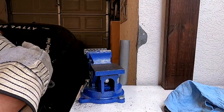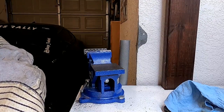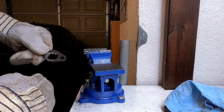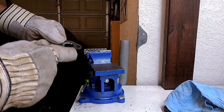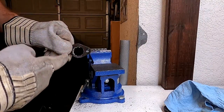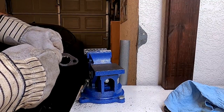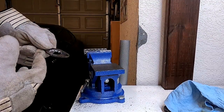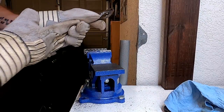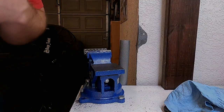I've got the washers I'm going to weld onto the chassis of the cart so the pedals aren't moving around so much, which I don't like. This is not going to stay this way — I know it looks like crap, but I am going to get a die grinder bit and get that grinded out nice and smooth. So let's get this pipe in here, get some measurements taken, and look at cutting this pipe and getting it ready to tack.